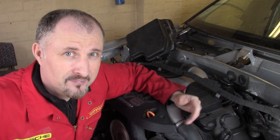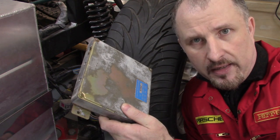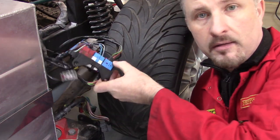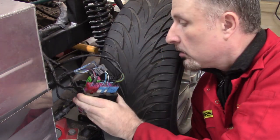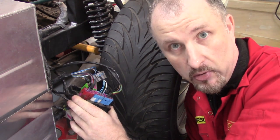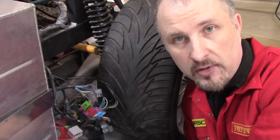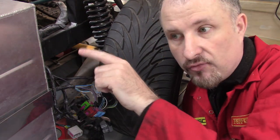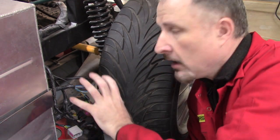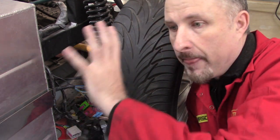What I did on the prototype is I went to a scrap yard, found another donor car and basically chopped these plugs out so that I've got two sets of plugs. All I have to do is make an extension loom from here to the wiring loom of the rest of the car, which is now in the back of the car. So all I had to do was move the ECU to the back of the car — on this normally aspirated engine there are five plugs. This is connected to the front part of the wiring loom and the loom is run down the inside of the car, all protected inside the pod or nacelle of the car.